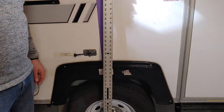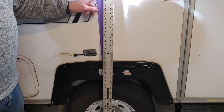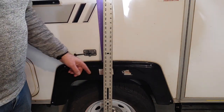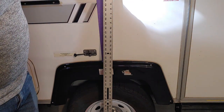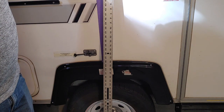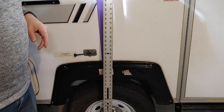And now with the tongue six inches high: notice the entire strip is now up behind the vertical line, which always stays with the axle. So you have the back part of the camper, which is always behind the center of balance, but now you also have this much of the front of the camper behind the axle, shifting its weight rearward — and that is why your tongue weight keeps getting lighter as you go higher.